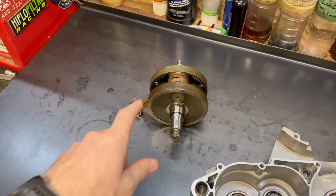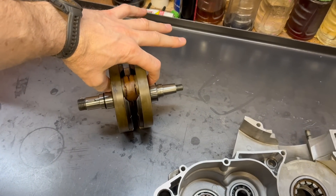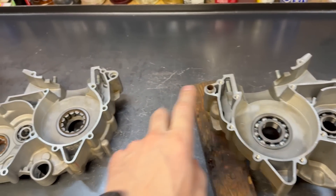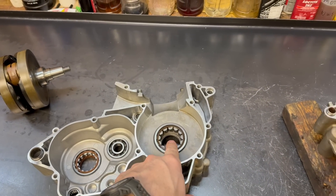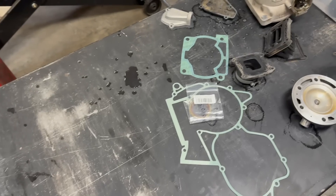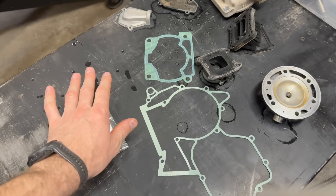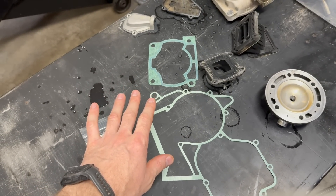This engine did have a minor crank bearing failure. If you're familiar with the Betas, you know that this has been kind of their Achilles heel. Just to verify, I did measure the crank width and check that against the space between this bearing and this bearing, and I have about 20 thou of clearance. Something that may also be interesting to some of you is that the aftermarket gasket kits for these are backordered right now.